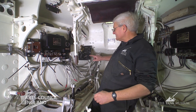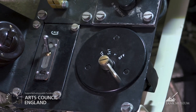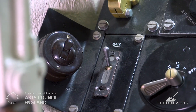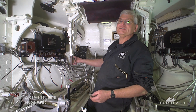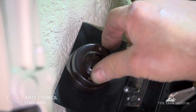This is the lighting switch. You've got an off position, tail lights, side and tail, and then all the headlamps on as well. As mentioned earlier about the convoy lamps — the red and blue — there's a switch which allows you to select either the red or the blue tail light. Then this little domestic-looking light switch enables you to turn off the right-hand headlamp for convoy duties.